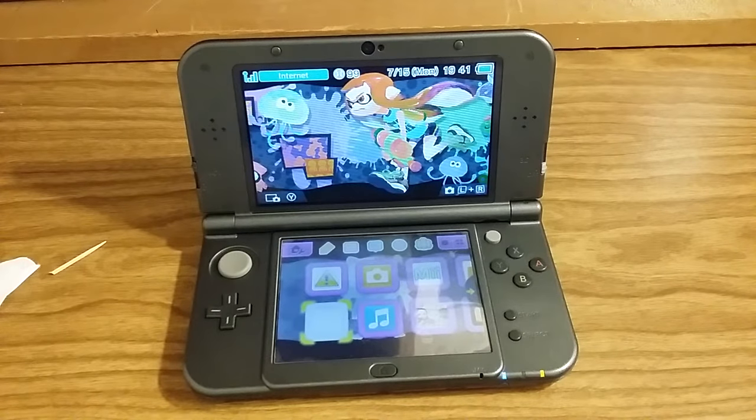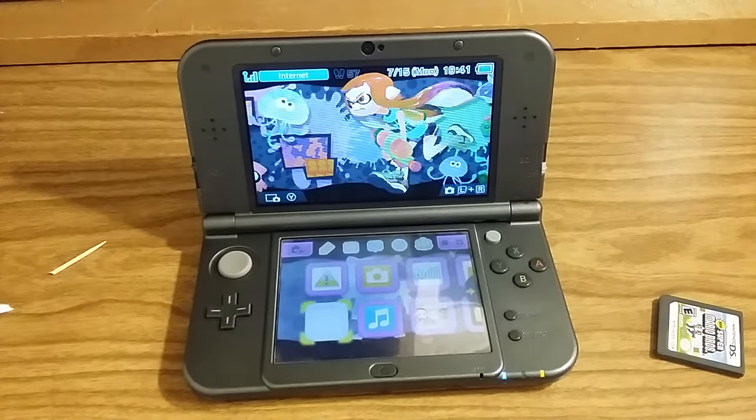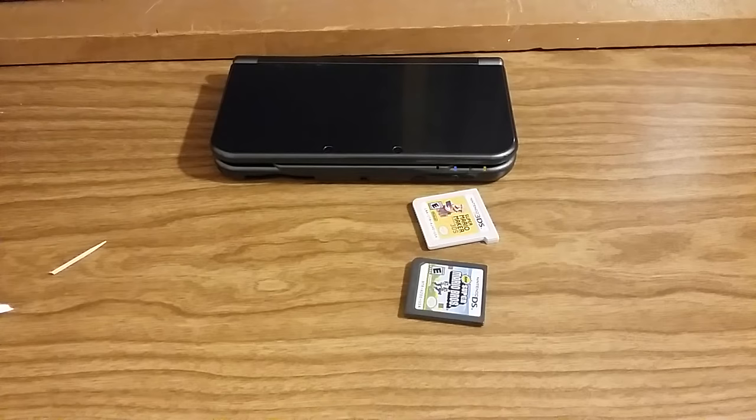Before you attempt to clean your cartridges, I suggest you try pumping or blowing air into your cartridge slot first, because that might be the only problem and you don't want to go through all the work of cleaning your game cards when it's just dust in the slot. That's today's video — thanks for watching, please like, comment, and subscribe to Nintendo Gaming Box. I upload randomly because I do YouTube for fun. See you guys later, peace out.